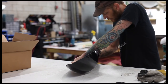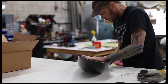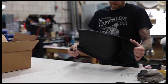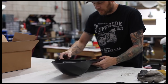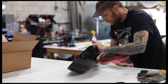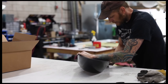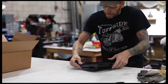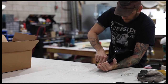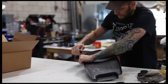I just got to deburr all these edges — we don't want a sharp edge poking through our cover. Some people ask me why we don't make these out of fiberglass, and my answer is ABS is very flexible. You can't bend fiberglass — it will crack. I've seen some brand new fiberglass seats that a month later they're all cracked and garbage. I've seen these on bikes for over four or five years, got a couple back for recovers, and they're still perfect. We might one day do a select few seats in fiberglass, just because it might be a little easier time-wise.